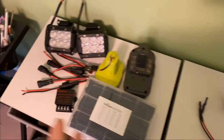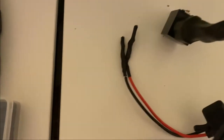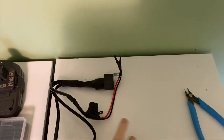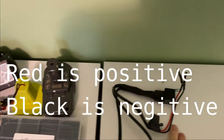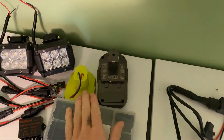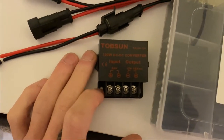I've already wired these lights to my bike, but I'm redoing it for this tutorial so my wires are already clipped. Coming off of your fuse on your wiring harness, there's a positive and negative terminal. If you're using a 12 volt battery, these are going to go directly to your adapter. If you're not, these are going to go to the output of your DC to DC converter.